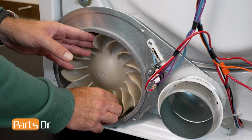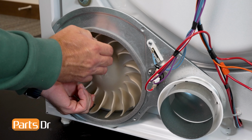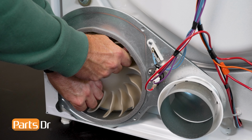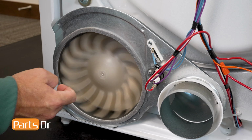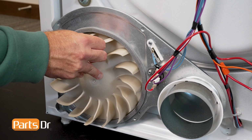While the wrench or pliers are on the motor shaft, move to the rear of the machine to attempt to rotate the blower fan blade. Please remember that this blower fan blade is attached to the motor shaft with reverse threads. Use two hands to grab opposite sides of the fan blade and firmly turn the blade clockwise until it loosens. You may want to wear protective gloves as some of the metal edges around the blower fan housing can be sharp.